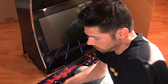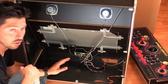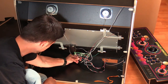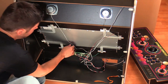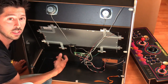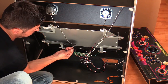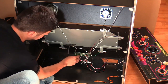So we don't need to exchange that video board, but I'm going to do it anyway just to show you in this video. So if you do have a bad video board, you'll know how to swap it out. You want to check your video connections: the HDMI connection going to the control panel, the HDMI connection going to the monitor, and the video cable going to the monitor. When swapping it out, always grab the connector, not the cables — because if you grab the cables and pull, you're going to rip them out from the connector. Always grab the connector itself and wiggle it out. Sometimes there's hot glue you have to peel off.